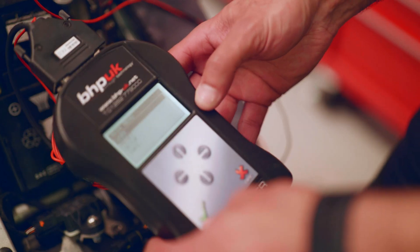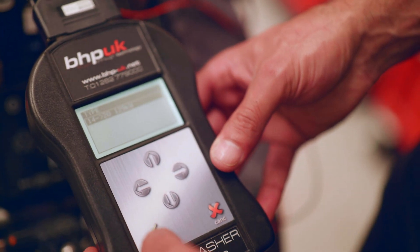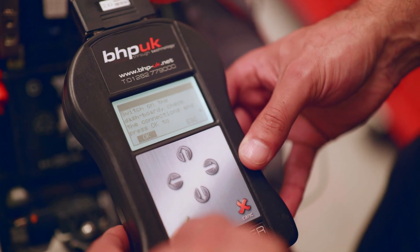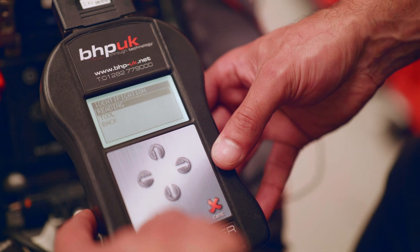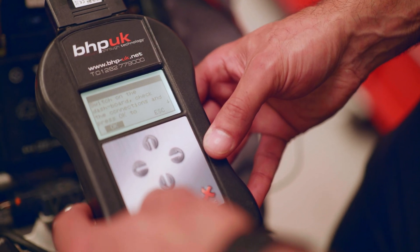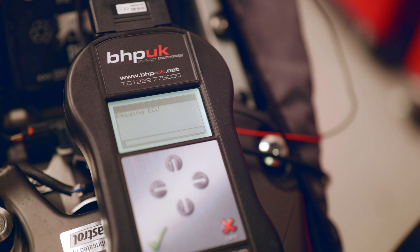To start taking the read, we simply click on work and select the vehicle that we have. You get a second check screen to tell you the year of your vehicle. You simply follow the prompts on the screen. Switch on the dashboard means switch on the ignition — you'll be asked to do this a few times. The ECU flasher will automatically select the protocols it needs to use. You just click on reading and carry on following the prompts. The length of time it takes to read the ECU depends on the vehicle — some are as short as two or three seconds and some can take 10 or 15 minutes.